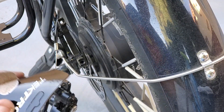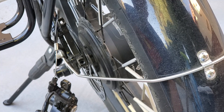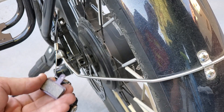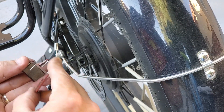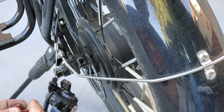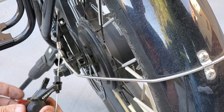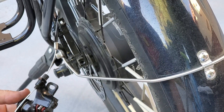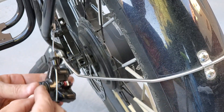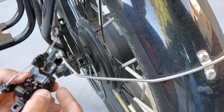Grab our new ones here. We've got our brake pad — we're just going to slide the spring over the top and then align the other one in the spring. Then we'll reverse the process and push them up through the bottom of the caliper. Then we can take our cotter pin, line everything up, and slide it through.